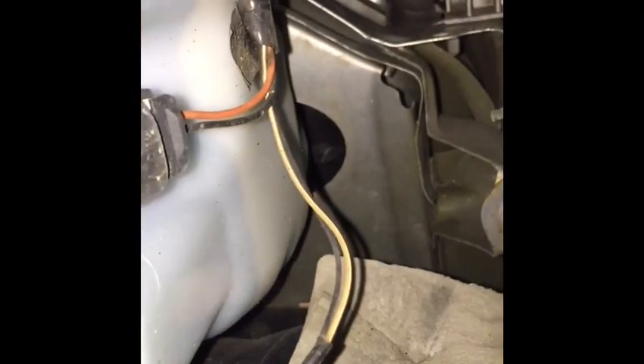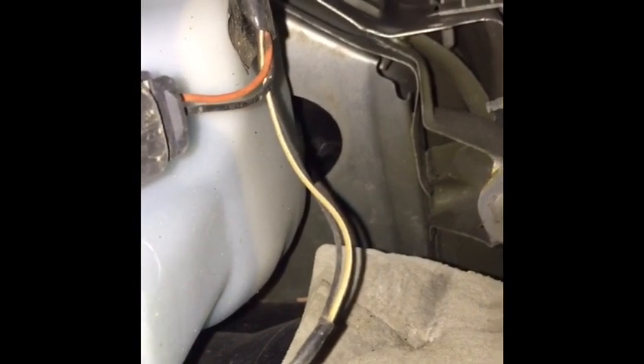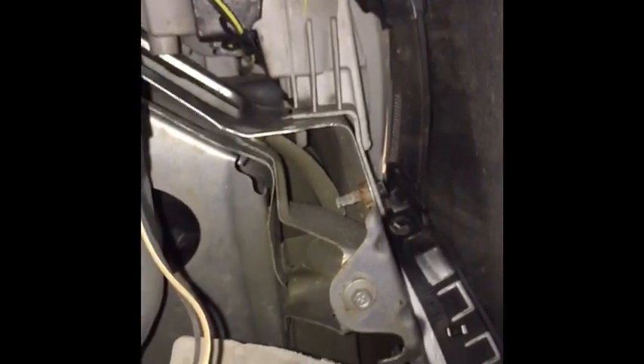You can probably bend this bracket here, which I'm actually considering doing — this is like the third time we've replaced this bulb. Your hand gets kind of nicked up, but that is exactly where it goes — right where those black and yellow wires are, that's the low beam bulb. The technical procedure is you're supposed to take off the entire front bumper.